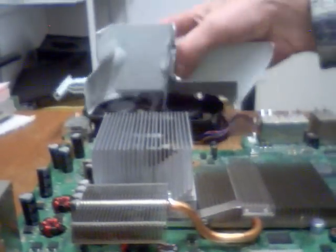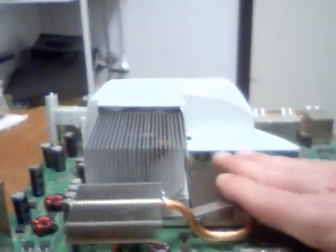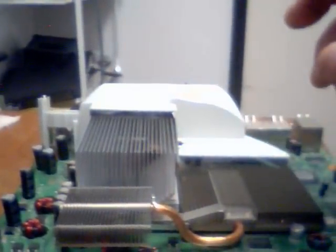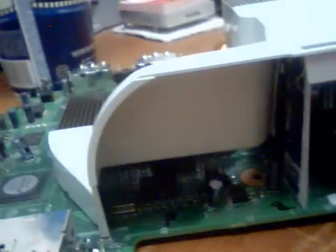This piece of cardboard goes all the way down to the motherboard, just like that, and separates them totally. All your air is going through here from one fan, all your air is going through here equally, and they all stay cool. Remember that. I highly recommend you do this to any Xbox that you are willing to open. All it is is a piece of stiff cardboard, a little bit flexible so that you can get around some of your capacitors. I figured that might be a little bit of a problem, so I made it flexible enough so that it does not affect any of the capacitors.